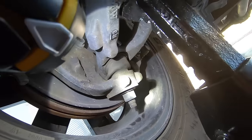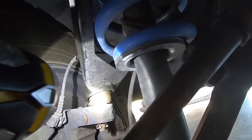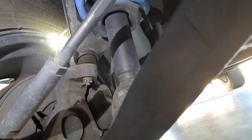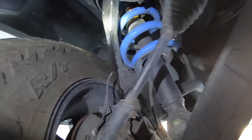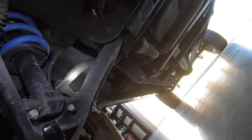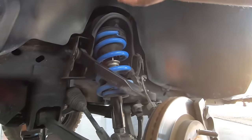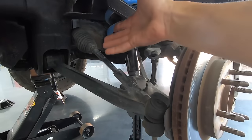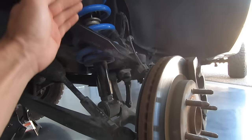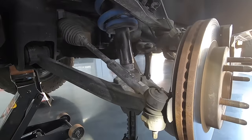Over on the passenger side — lower ball joint looks good, no tearing, no apparent wear. That is the stock lower control arm and stock lower ball joint. The upper ball joint is with the Rough Country kit and it looks good, just like the other one — just a little bit of residue coming out after 30,000 miles, which is to be expected. This side's strut boot is pretty torn up as well, but this truck does have 131,000 miles on it so that's to be expected. Now the weak point I am worried about with this kit is the tie rod end. Because the front is 3.5 inches higher, the tie rod has not been extended, dropped, or compensated in any way — it's just extended outward and aligned to compensate. That means it's at a more interesting angle that will wear out quicker than on a stock truck. But we are 3 years down the road and it's still running aligned and perfect.